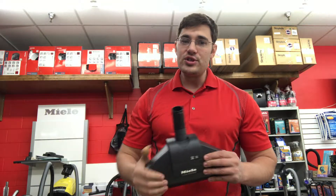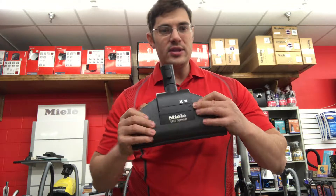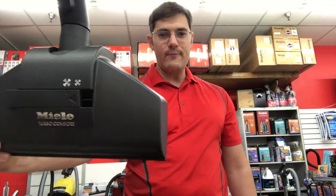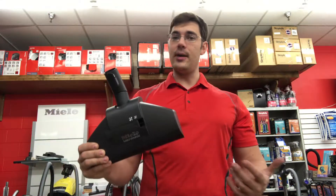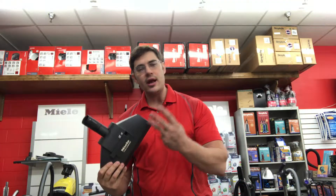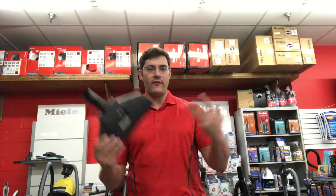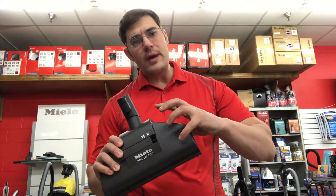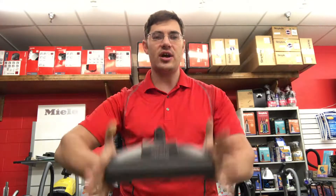Miele thought up something really smart. The Germans think of a lot of detail when they design things. They put this little door on top — you can slide it open and it opens up a little air channel, giving you better airflow to reduce over-sealing from too much suction. You need airflow to grab the dirt and pick it up. There are three things that help with cleaning: agitation, airflow, and suction power. Controlling your suction power can offset airflow and help with agitation, instead of having too much suction and bogging down.